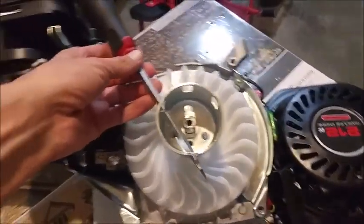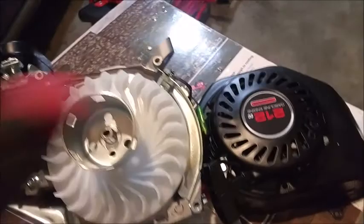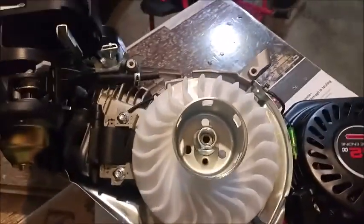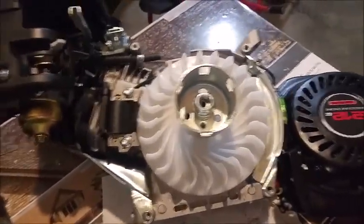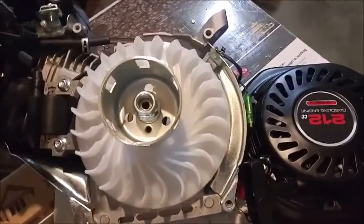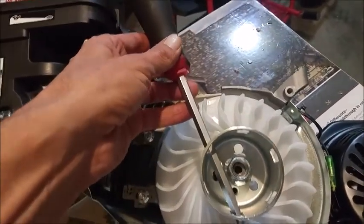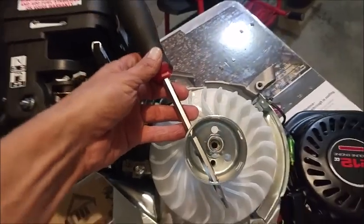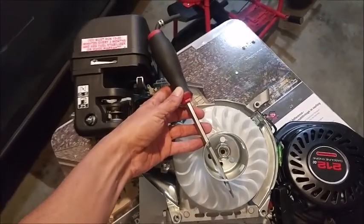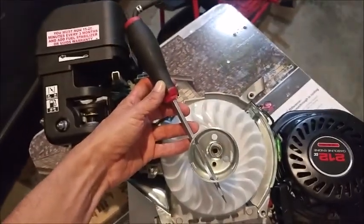One I learned when I was trying to take off the flywheel nut, you can see I've already done it. I'm thinking, well, how do I hold the motor in place? I just watched a tutorial, and the guy had some big strap that was wrapping around this. I'm thinking, well, what am I going to do? Don't have that. So I actually spotted these two holes, and I ran my big standard screwdrivers, Phillips around the same size would work as well. Back this up a little bit. Positioned it here. I know I had the motor standing upright on its base. Positioned it right like that.